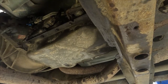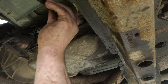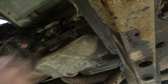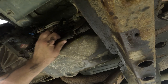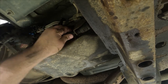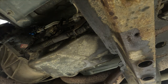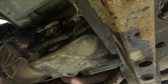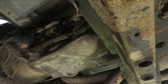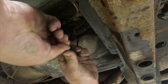Alright, let's tighten it up. We're bolted back up. Let's straighten our bracket piece back out. I did break the shift cable linkage — but that's back in place. Slide it back in, snap it in. I almost lost the retainer. It's got a broken plastic tab, I don't trust it. The metal's staying in there, so I'm going to do a zip-tie fix to keep it in place.